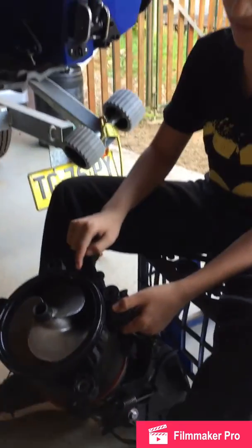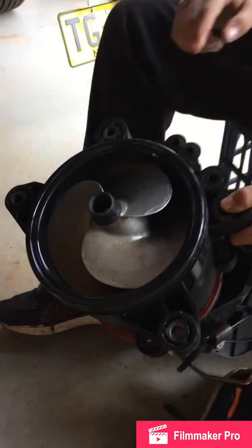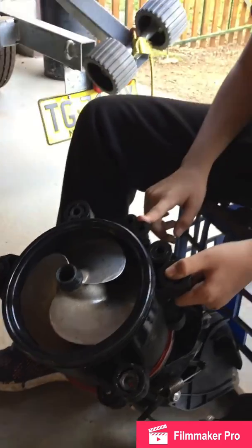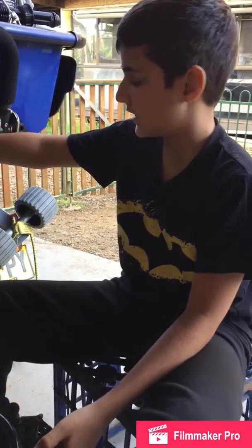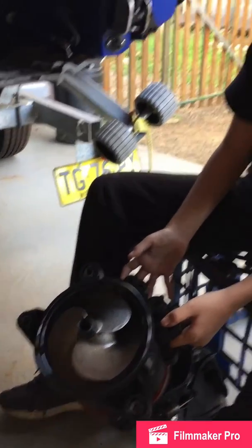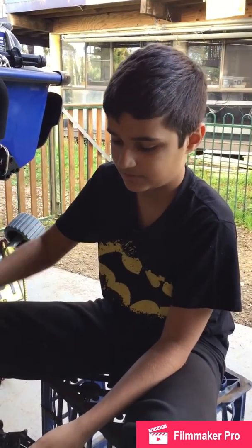We've put some XPS lube on this rubber seal. Now, you've got to have 2 people to put this jet pump in, because one person's got to align the drive shaft and put it in here, while the other person pushes it to the front. Now, I'm going to do that off camera and I'll see you soon.